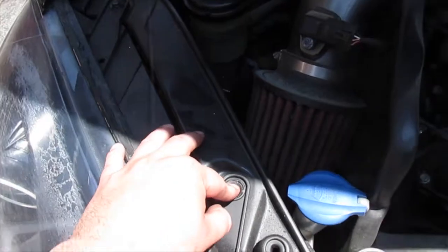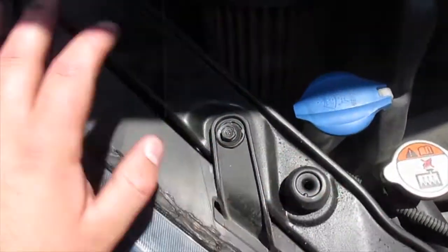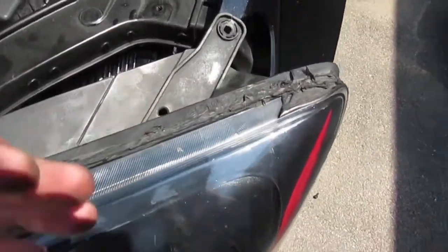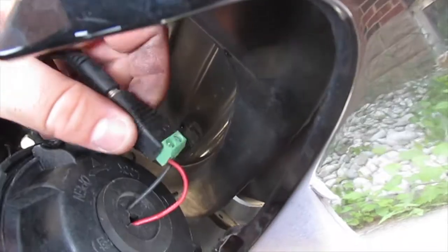Anyway, this is what you should have as a finished product. Now you can take out these two 10mm bolts — this one here and this one here — which will pull the headlight right out. I don't recommend taking these off until after the bumper is off, because otherwise it's going to be sliding around. After you get the headlight out, pull it towards you and it'll slide out, and then you'll have a connector here that you just push down and remove. If you have a halo ring like I do, you'll have one of these connectors; if not, it'll just be a standard one. Move this tab and it'll come right out.